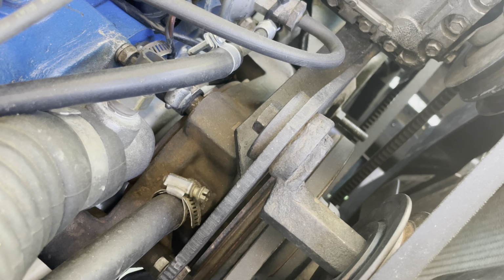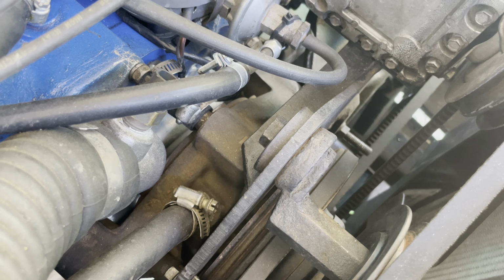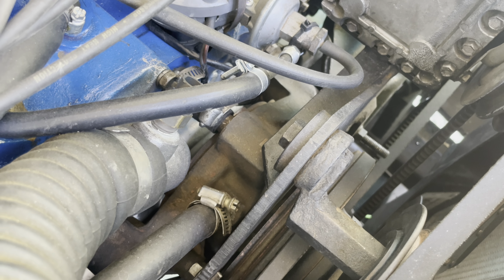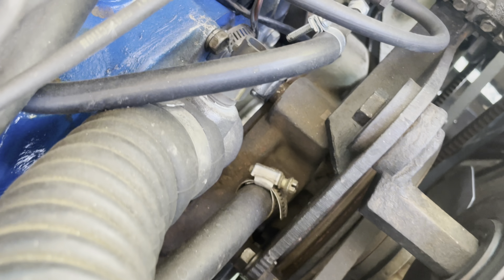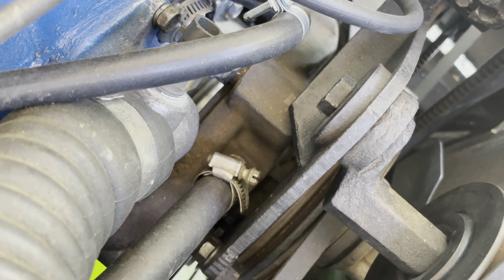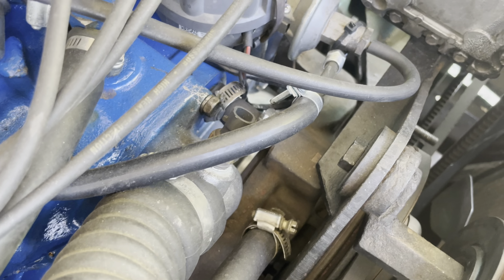And of course, she decides to start pissing coolant, which I diagnosed last week. I'm going to put that video in at the end of this clip so you guys can see it. It's peeing out of the front of the water pump. So, Mr. LA mechanic that works on Scott's stuff when it's there, maybe could have spent the 40-50 bucks, got a water pump, because that could have killed the rebuilt motor, and then that would have been on you.